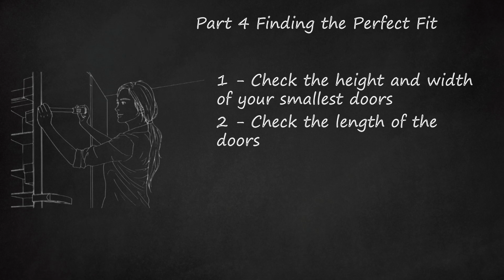If you need to move the refrigerator out past the end of the counter to accommodate the hinges of the door, you might be required to adjust your measurements. Start from 2 inches past the counter. Measure back to the wall the depth of the refrigerator. That point will be where the back of the refrigerator rests. From that point, measure outward the depth of the refrigerator plus the length of the door. That will be the length that the door extends into the room.